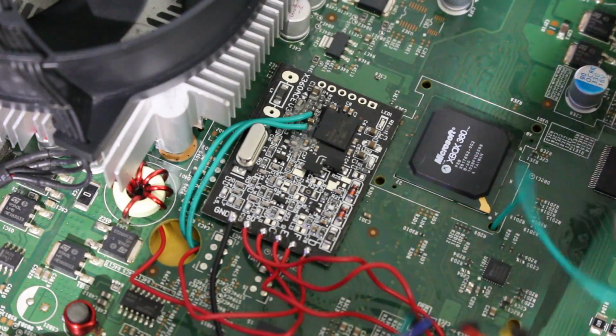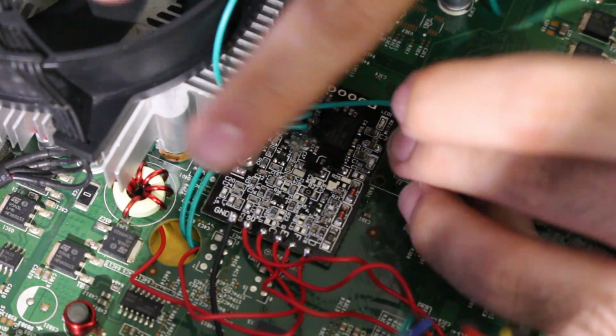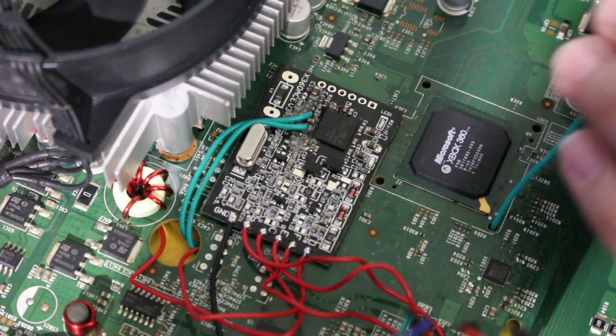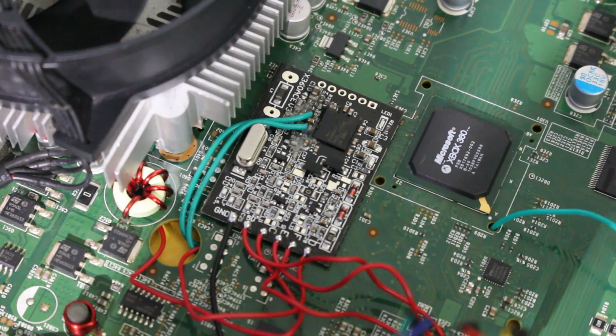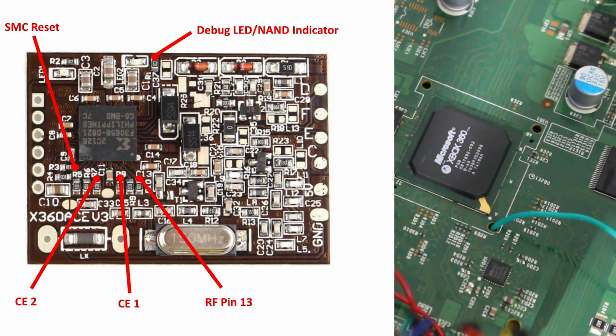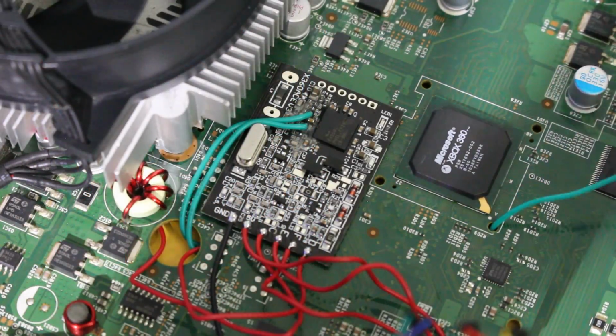Okay, so I have my wire right here. I'm going to trim it accordingly, probably to about like that length or so. I think that should be fine. And it looks like the point that we're going to be soldering to is right there. So we've already tinned it since we did that when we prepared the chip, and I'm just going to solder into that.